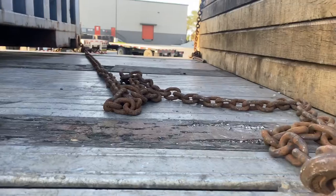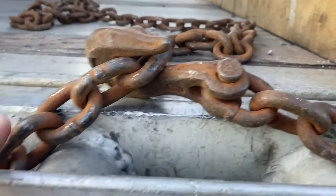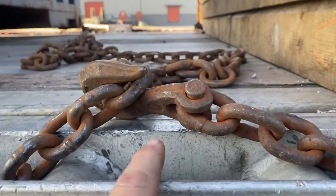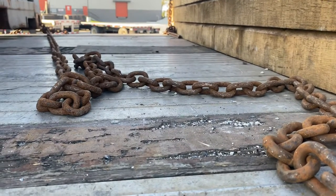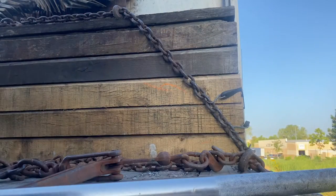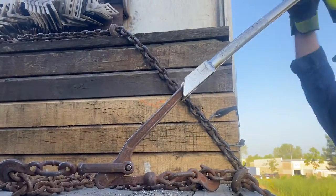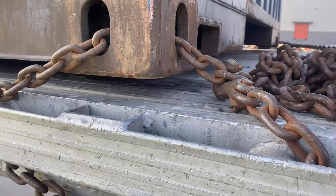From the other side, take the chain and wrap it around two round posts up front, just a little bit above where the container is. Wrap the chain around, hook it back into itself, and then right in this area we're going to put a snap binder. With the snap binder connected on the chain, we're going to snap it.